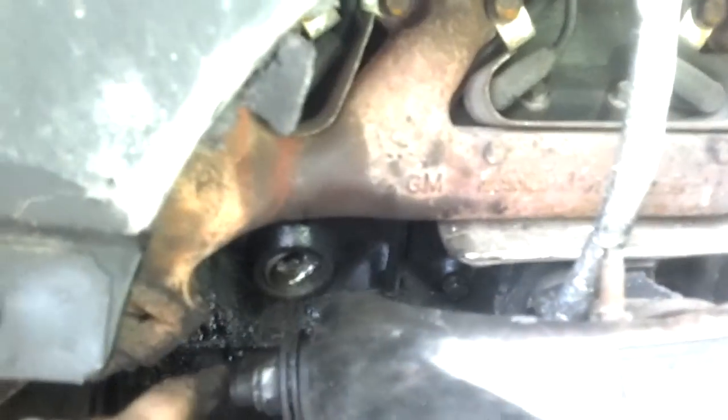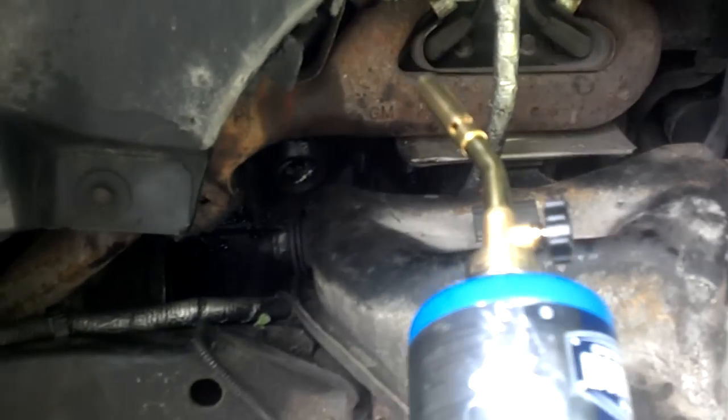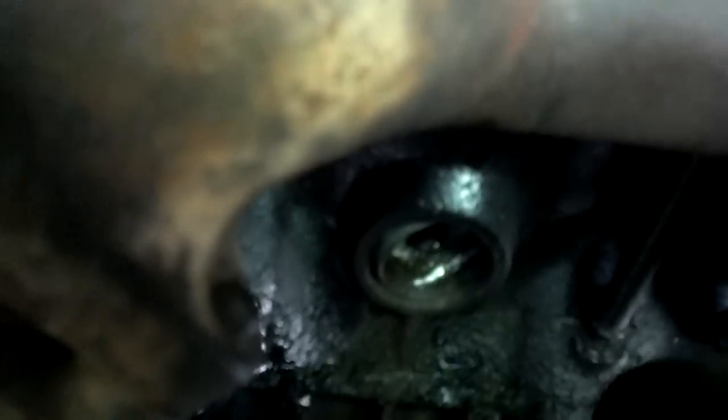If you ever get in a pinch — and I haven't seen a really good video on it, and this ain't going to be a good video by any means — but if you ever get in a pinch and that sucker doesn't want to come out, you don't have a very straight hole to hit through here to try to knock the edge of it. Just go ahead and use a little old propane torch like this here. Heat up around the metal and let it get to where you start seeing the red come through on the outside of that ring.